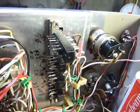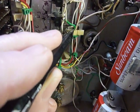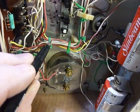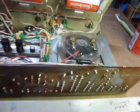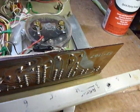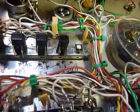I turned it on and it still didn't work. These clamps that hold the wires were all broken, so I put little green tie-wraps on there just to keep the wires bundled together. I worked and worked to get this thing to operate. I cleaned the circuit board with 90% alcohol and could not find any problems there. I examined the switches carefully with my Luxor 8-power headband magnifier and was not able to find anything.